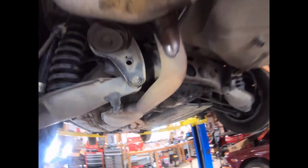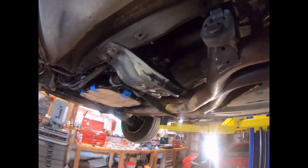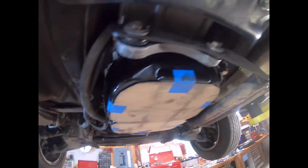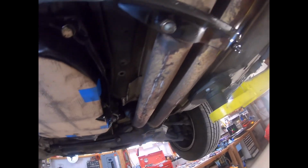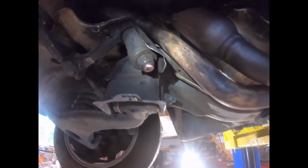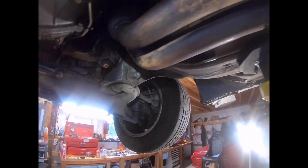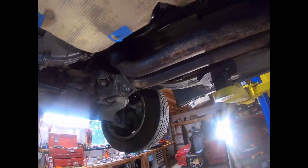Hangers back here. There's a hanger just here. Hanger right here. The two spring hangers off the back of the transmission. These two bolts here, and all culminating in the front and left manifolds here. But as you can see, you can't really get a decent angle on it. To get the front part of the exhaust up in there, you've really got to get the angle kind of perfect. It's almost perfect when it's, like I said, flat on the floor.